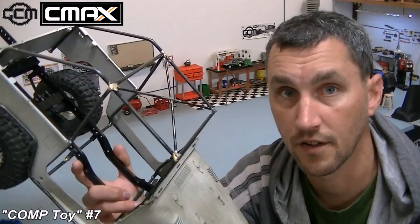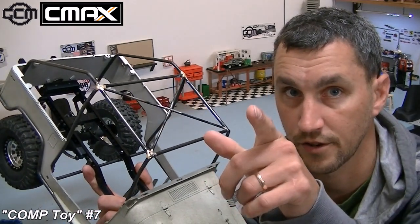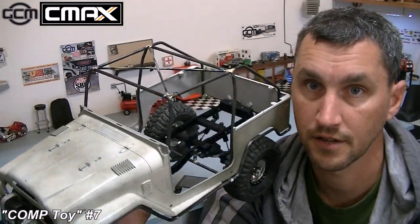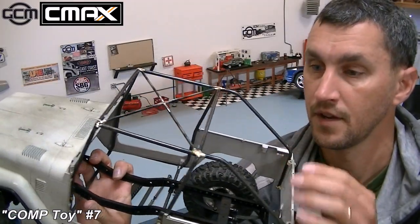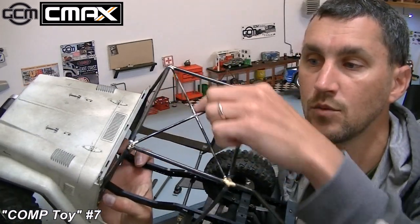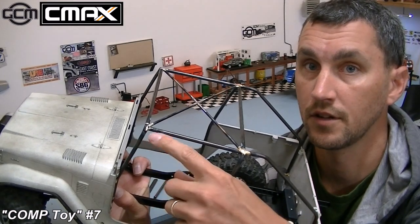The reason I say all that over and over again is: don't be discouraged. If you get your tube work started and it still feels kind of floppy and flimsy, don't get discouraged. Because when you get it all done you will see a huge improvement in the strength. So basically in the last video we had these two down rails, the back cross bar, the top front cross bar. And then I've added the 3/16ths tube here in the sides, and then the 1/8th-sized small X in the middle. That's all I need up here. This thing is incredibly strong. I will probably put some little hand hoops here.